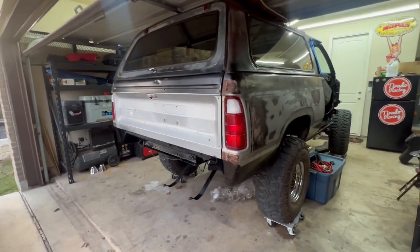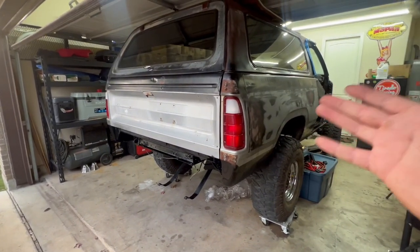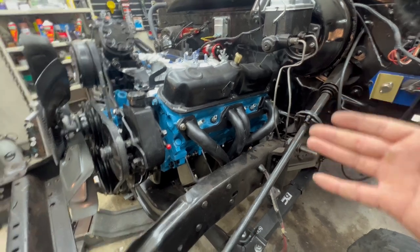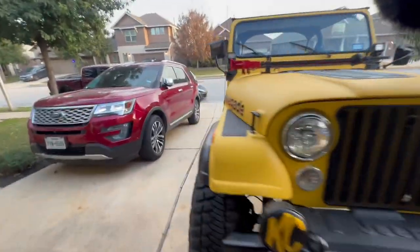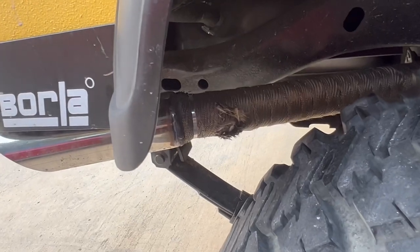If you're new to the channel, we've got the sport rear bumper, front bumper, and bird bath hood — not period correct, but they look absolutely sick on there. These are Hedman headers for the Mopar 318 engine. The rest of the exhaust will be done by my friend at A&M Exhaust on Instagram — we're doing a high-clearance exhaust so we don't have issues when we go wheeling. That's actually really important because on the CJ, when the suspension starts flexing with the 35s, it started rubbing the exhaust and going through the header wrap. Alright guys, that's going to wrap up today's video — hit that like button and leave a comment below. Until next time, peace out.